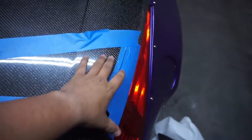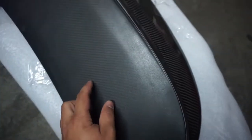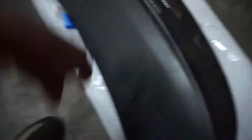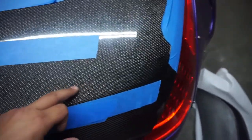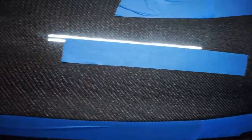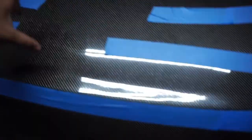So I had the wing mocked up where it needs to go and I just outlined it with some blue painter's tape so I know that this is where the wing is going to line back up perfectly. Now on this edge right here, it's pretty thin and I don't want the screws to go through. So I measured about two inches to the center where it's really hollow inside and I just marked it here so I could put the screws along here. I think I'm going to do like eight screws. I'm going to start off with the very edge ones to see how it goes and then I'll go ahead and do the middle.